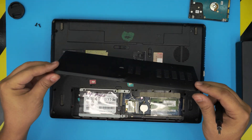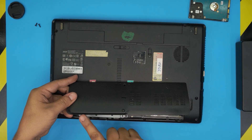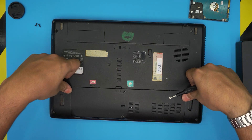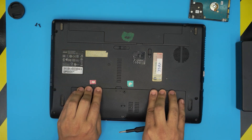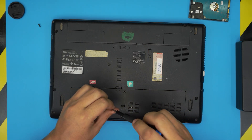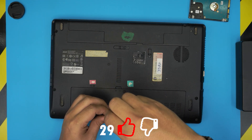The two other screws still go in from the outside. Bring the bottom cover — put the bottom end first, then the front end of the laptop. Squeeze the sides first, then press the long section along the front, and finally grab the screws and put them back in.